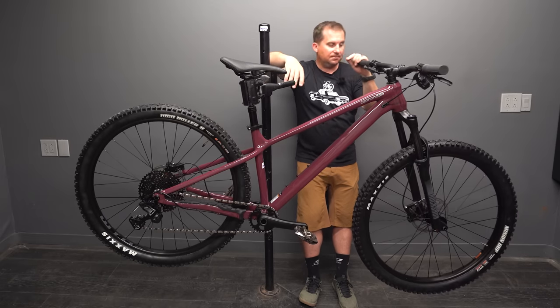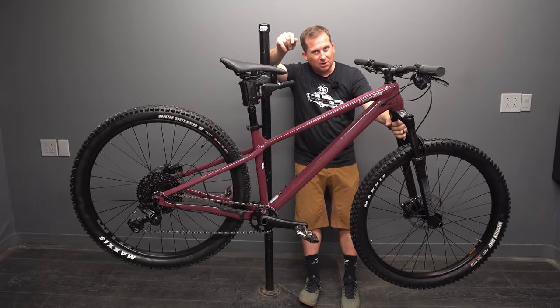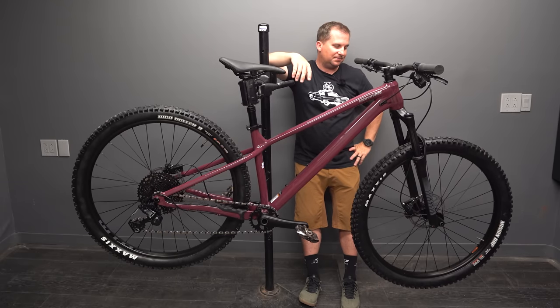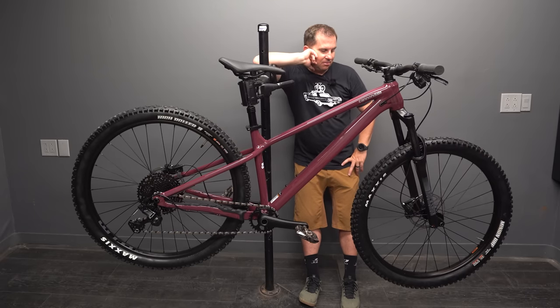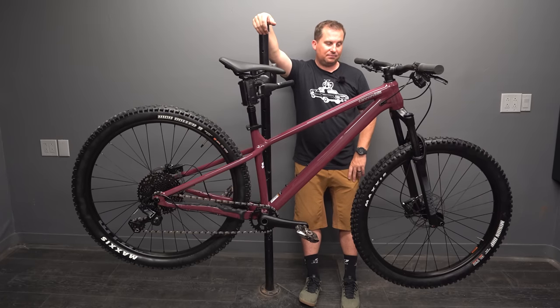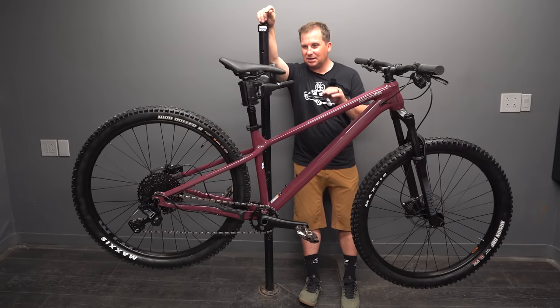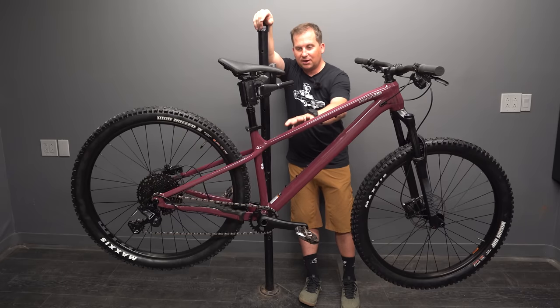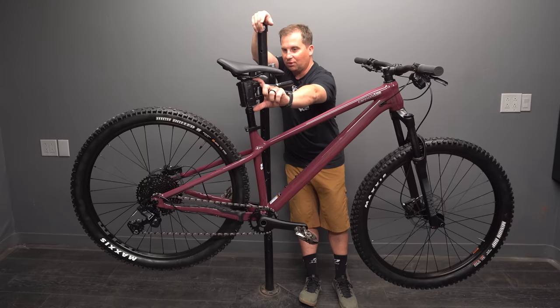SRAM Level brakes. Up front, we've got a RockShox Judy. I'm a little bit disappointed by that. It's a 32 mil stanchion fork. I haven't had great experiences with the Judys myself, but at least it's an air adjustable fork. But man, when you compare it to something like the Giant Fathom, spec-wise, the Fathom has that much better fork. And another weird thing they did is, this is a size medium, it comes with a 120 mil dropper. We've got a super short seat tube, tons of standover, but a really tiny little dropper.